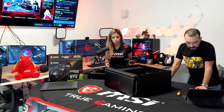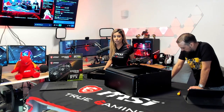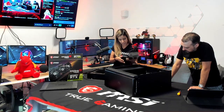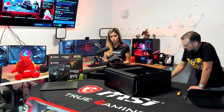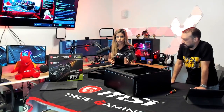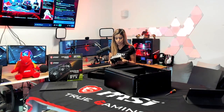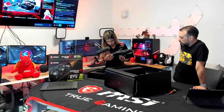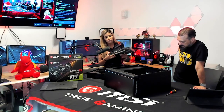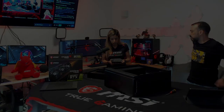After we finish building the PC, I'm going to benchmark it before and after overclocking. Today's session will be without overclocking; once Shon and Nati are back we'll overclock both CPU and GPU — I use MSI Afterburner for the GPU. Regarding connectors: when installing this GPU, first make sure it fits in your chassis, and note that this card requires three 8-pin power connectors from your PSU, so make sure your PSU has those cables.